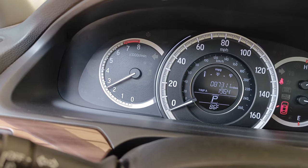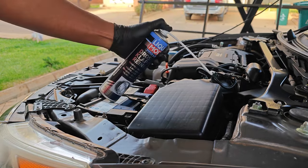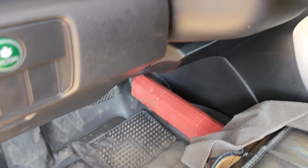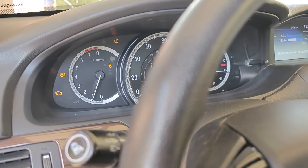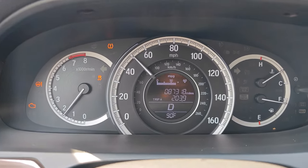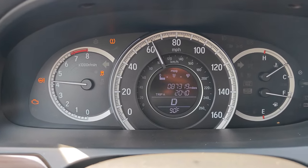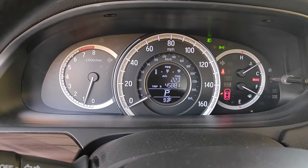This time I had the engine at 2500 rpm, just in case that would help, and same as before I completed this in about 10 minutes of spraying. Once I was done, I noticed that the check engine light and other warning lights were on on the dash, and the car was misfiring. For this Honda, all these lights simply tell you that the ECU is dazed and reporting an engine problem. I went for a second spirited drive to clear the product from the intake system, took it easy initially until the missing cleared up, and then put the pedal to the metal. After about three drive cycles, all the warning lights turned off on their own.